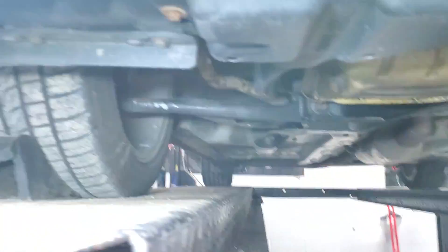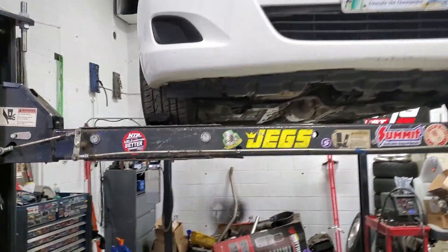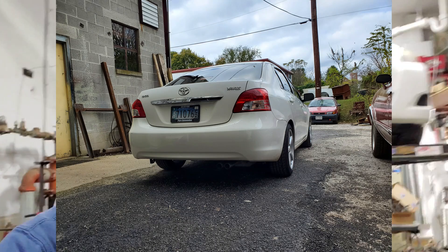Today, because I am tired of this thing sitting high, I'll put my drop springs back on. I know that puts my control arms in the worst spot — I'm now in camber loss, not camber gain. Right now looking at my control arms, they are slightly up. That's not the way to have your control arms. But this is not my ultimate competition vehicle, so I'd rather have a little style, drop it down, make it look tight.